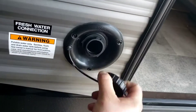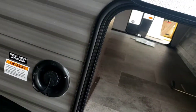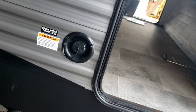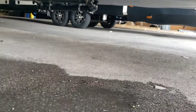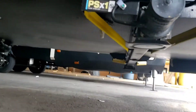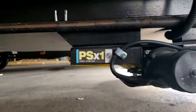Fresh water: this is where you're going to fill your onboard fresh tank. Just rest your hose in there, turn it on, it'll fill up. Watch the progress on the inside monitoring panel — don't wait until you hear water squirt out everywhere. I definitely recommend draining that after every trip; you don't want water sitting in there getting stagnant. And right there is the drain for your fresh tank.